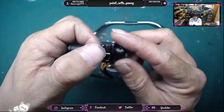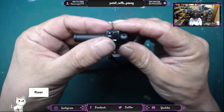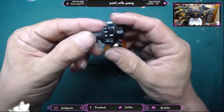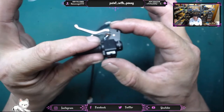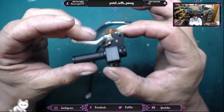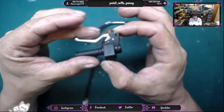The switch next to that is the horn, which is to warn drivers of your presence. Underneath that you have your turn signal — you pull it towards you for the left indicator and push it away from you for your right indicator, and to cancel your indicators you push it as a reset. This handlebar grip itself won't actually do anything because this is just a hold. And then you have your clutch lever — this is essential for smooth blending of the gears. Without it you would bang the gears in and the bike would jerk, whereas this lets you smoothly blend the clutch.